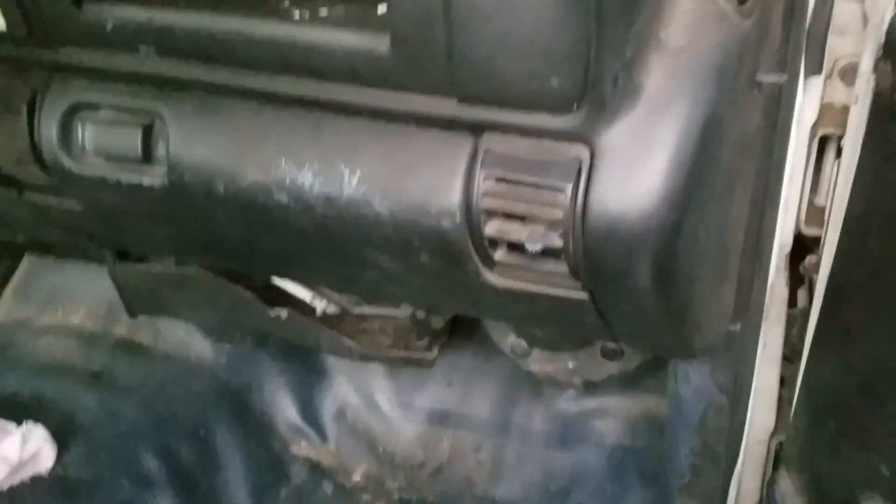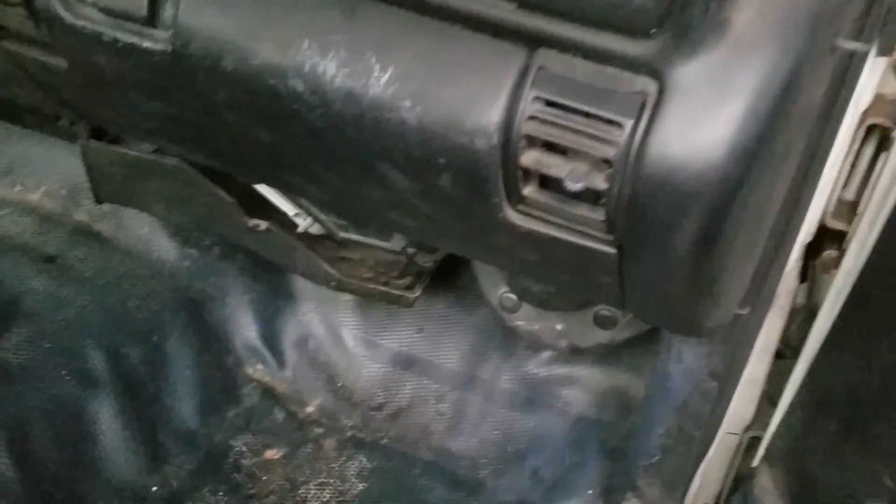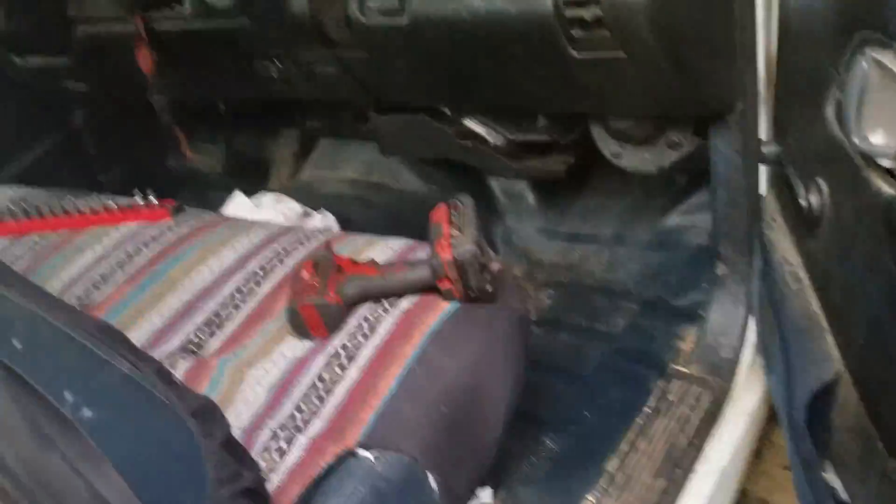You can check the heater core in the vehicle, but getting the cover off and back on is a real pain. Sometimes you'll break off a piece near the firewall. The correct way is to pull the whole dash and lift the AC box off the wall an inch or two, and then it comes right out easily. Anyway, investigated first before pulling anything. Now it's just pushing the cover back up, putting the six screws back in, and moving on. Peace out.